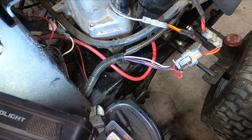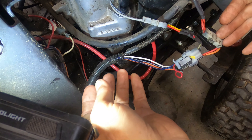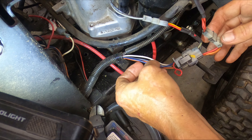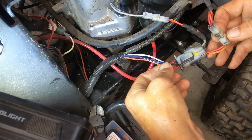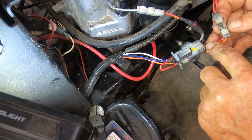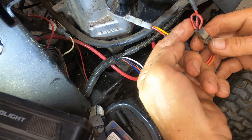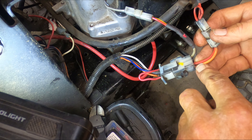Before I tidy things up, I'll explain the wiring — pretty simple. Four wires here. The solenoid wire, which is the blue wire, actually uses this red wire to jump over to the battery. And then this loop here comes over so it can go back up to the amp gauge.